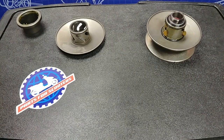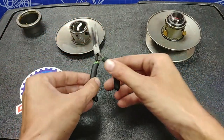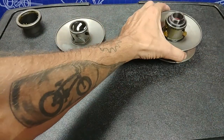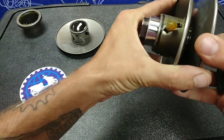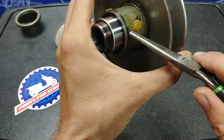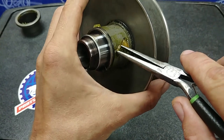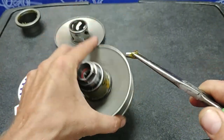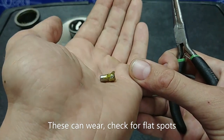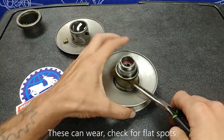Now the question is how to swap them out. There are three little pins inside your torque driver that fit into those grooves. So you're going to want to grab yourself some needle nose pliers. I like to go to about midsection — see all that grease in there? Don't worry about that; we're going to be re-greasing this when we're done. With the needle nose, you'll see that's your pin — there are three of these. Go ahead and remove each pin.